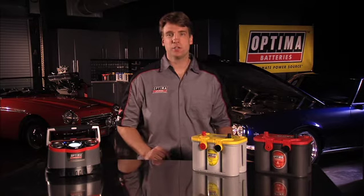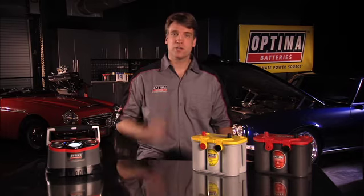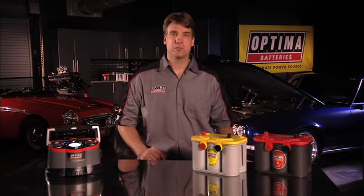If your battery is in an application where your vehicle isn't used daily and you don't use a battery maintenance device, there's a good chance that your Optima is never receiving a full charge. Starting your vehicle for short durations periodically during storage may actually be worse for the battery than just letting it sit. The energy used during storage and starting may actually exceed the energy you're putting back in, unless you actually take the vehicle out for an extended drive at freeway speeds for a decent amount of time.